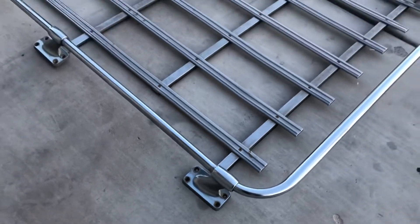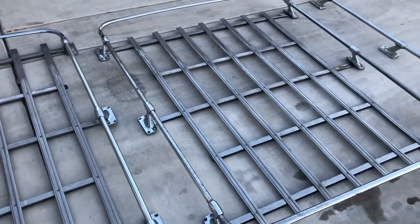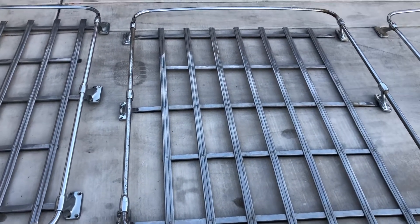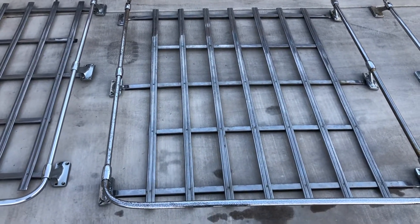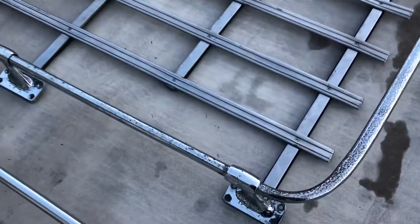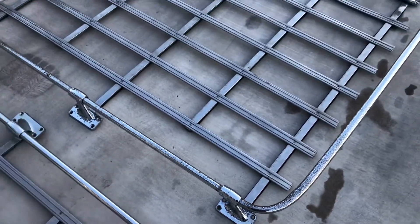These racks do mount on the back of 58 wagons. Now I'm gonna come over to the 59 luggage rack. Even though it looks very similar to a 58, it is about four inches wider, measuring almost 48 inches wide. Still 59 inches long. It has seven slats going across, and also has the six feet, three on each side. It also has the four holes that mount it to the roof. In 59, the luggage racks mounted towards the front of the roof on the car.